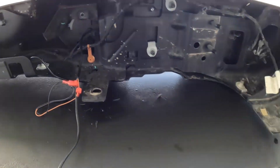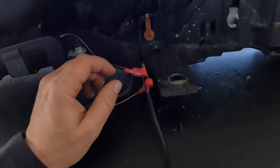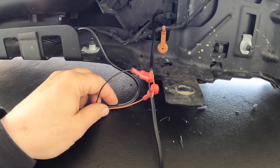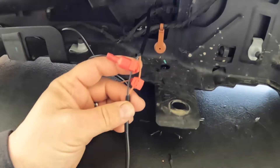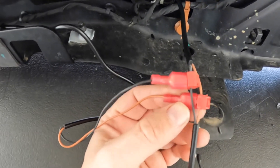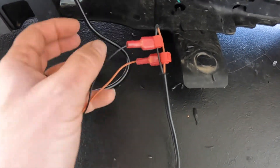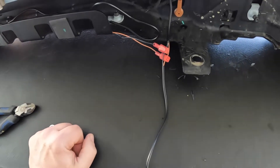The instructions say to actually run these wires up with the connectors up to the tail lights, but I'm going to do it a little differently — more similar to how I wired them on the Gladiator, where I tied into the reverse switch through the factory tow package wiring harness. I stripped away some of the thick outer sheathing on one side, ran the passenger side over and connected it to the driver side light, and I'll use the driver side wiring to get it to the factory tow harness. I'll wrap this up with tape, get it all zip tied up nice and neat, then reinstall the bumper.